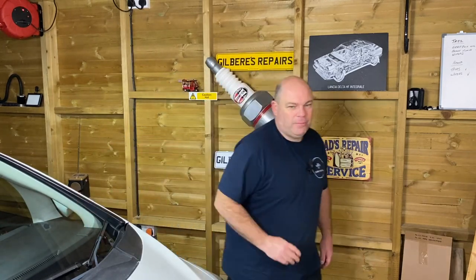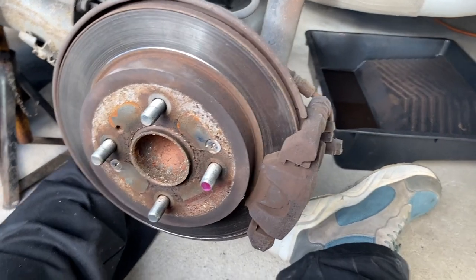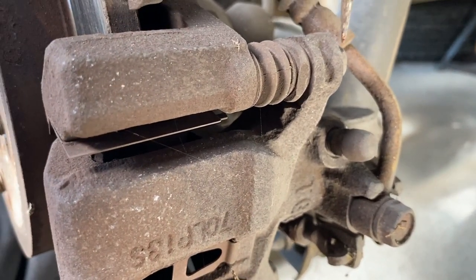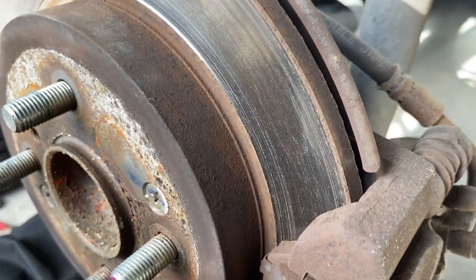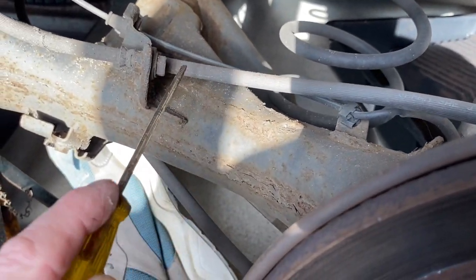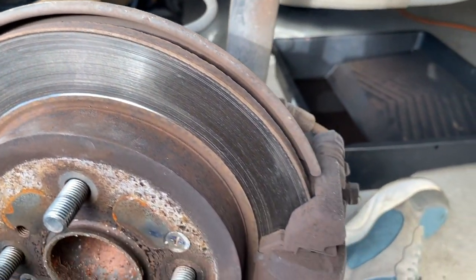Let's get on with it. We're going to do the rear brakes on this 2017 Honda Jazz. I've done the other side already. We've got two bolts — one upper bolt and one lower bolt to undo; those are the caliper bolts. When I did the other side, the brake flexi was a bit taut and doesn't give you much flexibility, so I recommend you undo that. I'll show you undoing that one just to release it from its bracket, and then we'll crack on with doing the actual brake job.